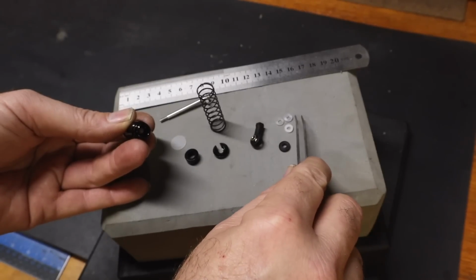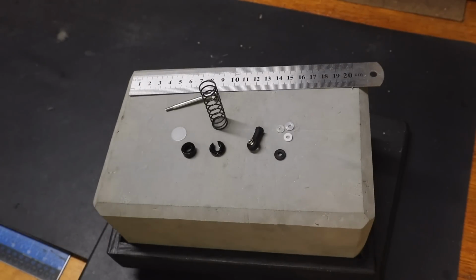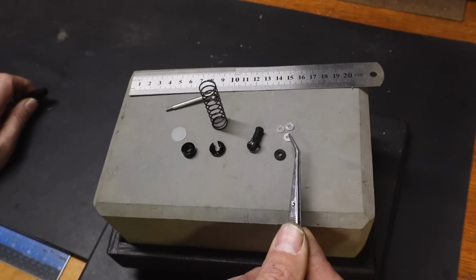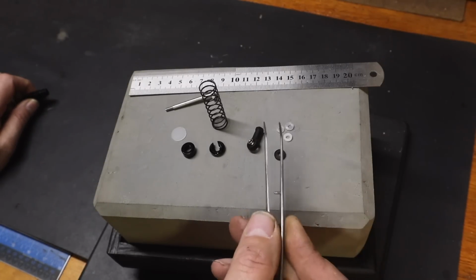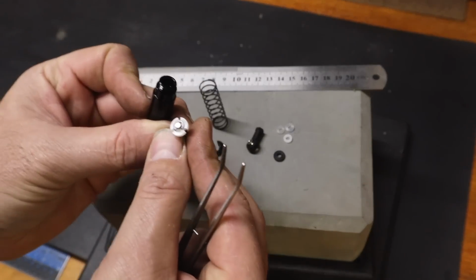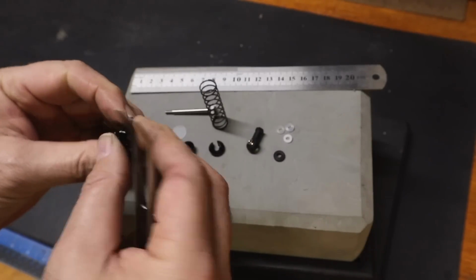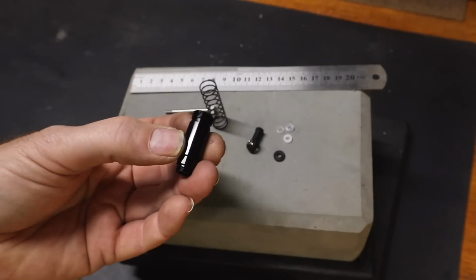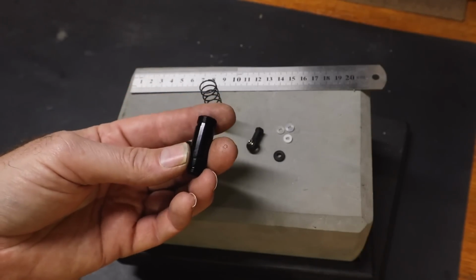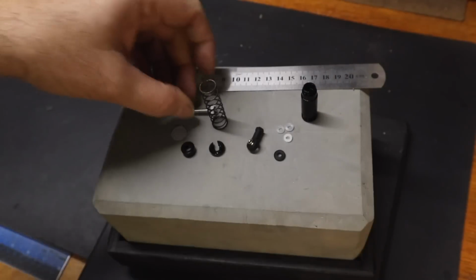But you will notice, do you see how there are 2 of them there and they appear to be radically different sizes? They're definitely silicone O-rings because they're absorbing the silicone. This one was wet. They do a little tiny little bit of wet assembly in the factory. You can see a little bit of gloss on the piston, which will aid in assembly. They do appear to be quite nicely made. And if it's anodization, it is a very thick coat on there. So the shock itself seems to be well made.